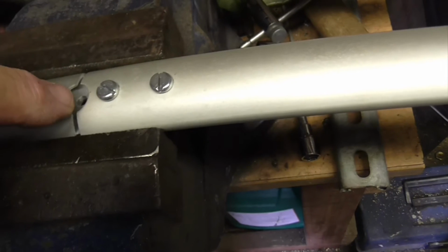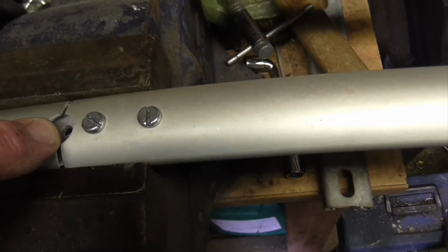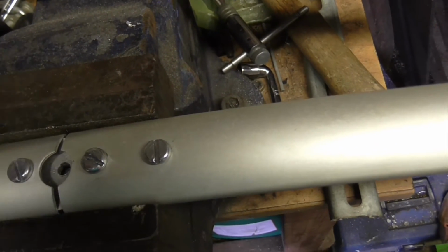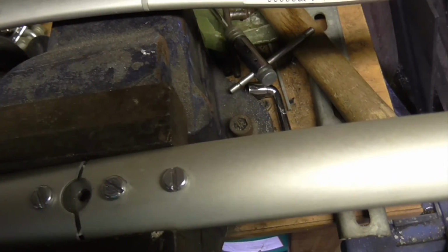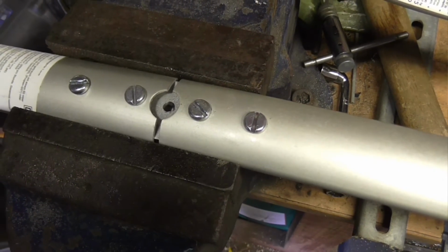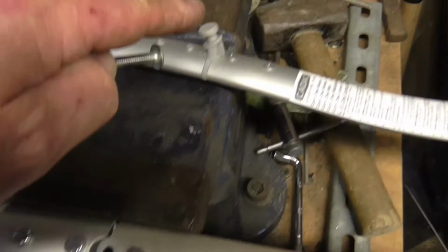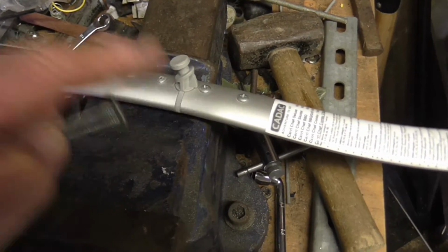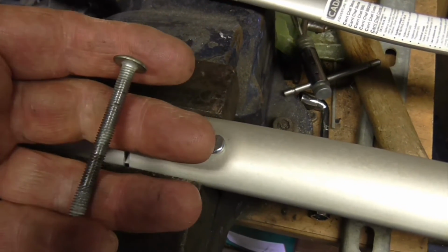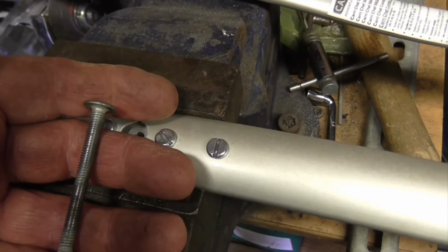I've drilled a hole in there, a tap-in size for M6, which I think is 4.8 or something like that. I'll just double check on that one. In my little set, which comes with tap-in size drills, it's a 5mm, so that's drilled at a sort of angle to simulate the angle of that. So I'm going to tap that out now, and I'll probably have to shorten this screw, and I'll probably put a little lock nut on it and also a dab of araldite to keep it in. I think you don't want it coming loose.